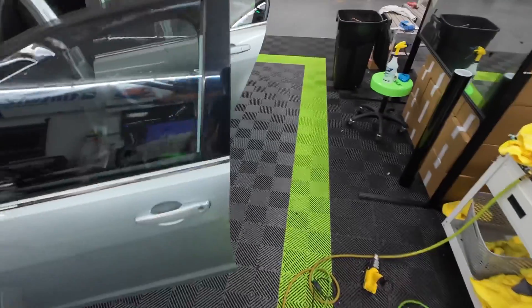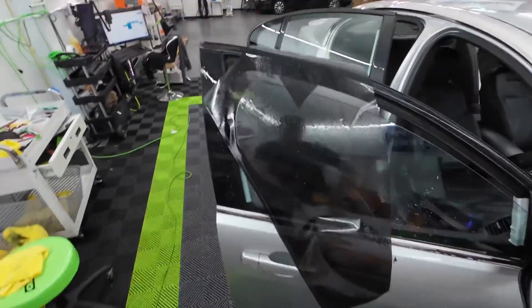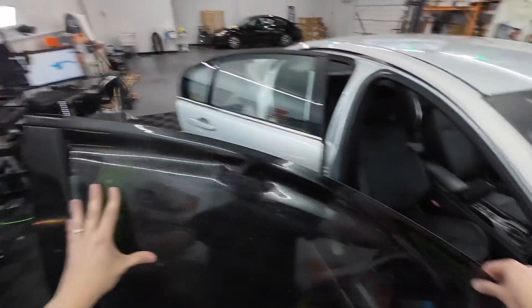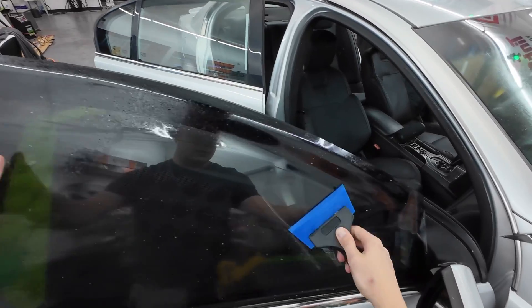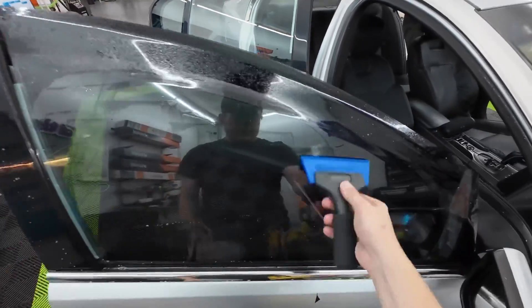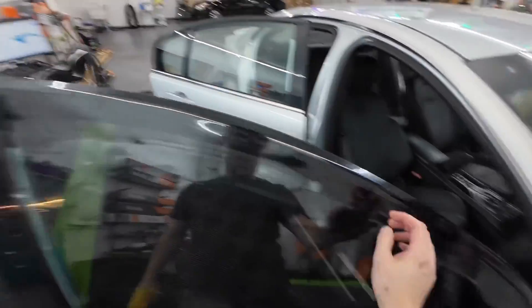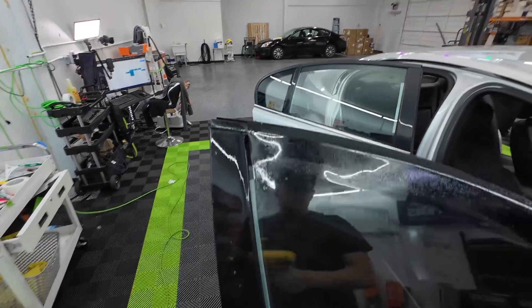There's one side shrunk. Don't fall on the hose there. Setting things up for shrinking — I'll always coat the window in a nice even layer of water. Take my squeegee, squeegee it from the center going down, center going down, leaving a little gap here and about an inch gap off the bottom. That gives you a good amount of space to get those fingers to pop on up.